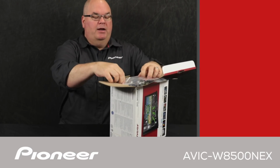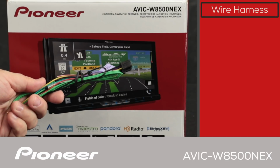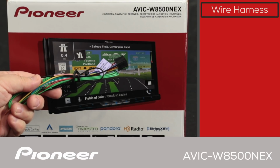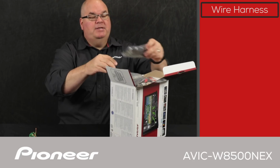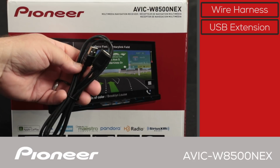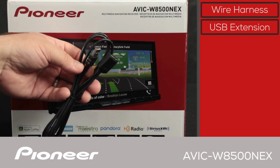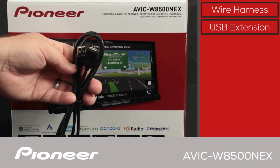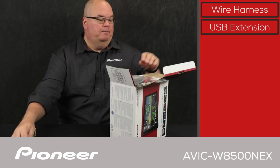Okay, the first thing we get here is the wire harness. Now, the wire harness we'll use to connect all of the electrical connections from the in-dash receiver to your vehicle, like power, ground, speakers, and so forth. Next up, we have the USB extension. Now, the USB ports on the in-dash receiver are on the back, so we include a USB extension in the box to bring that USB port up into the passenger compartment of your vehicle.